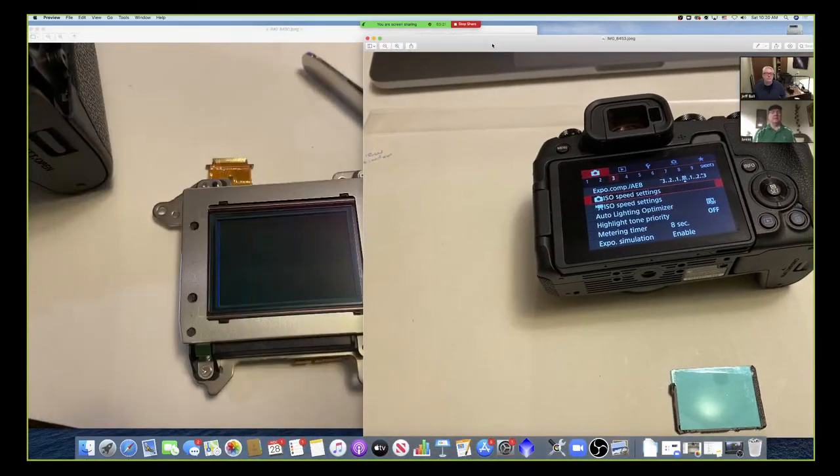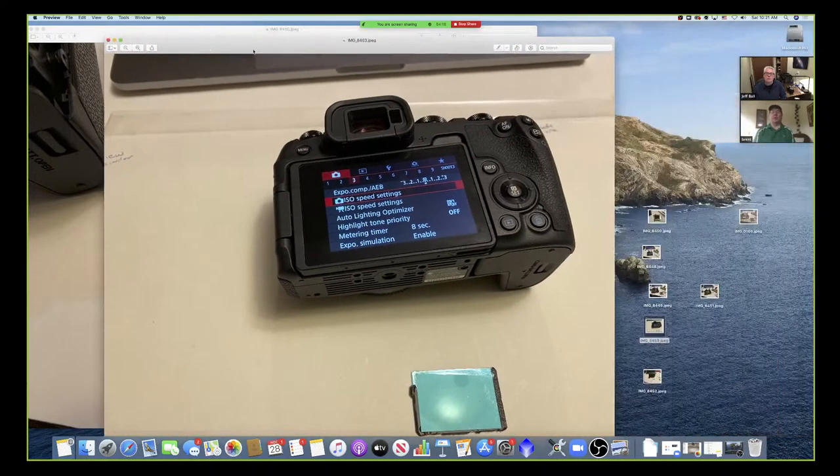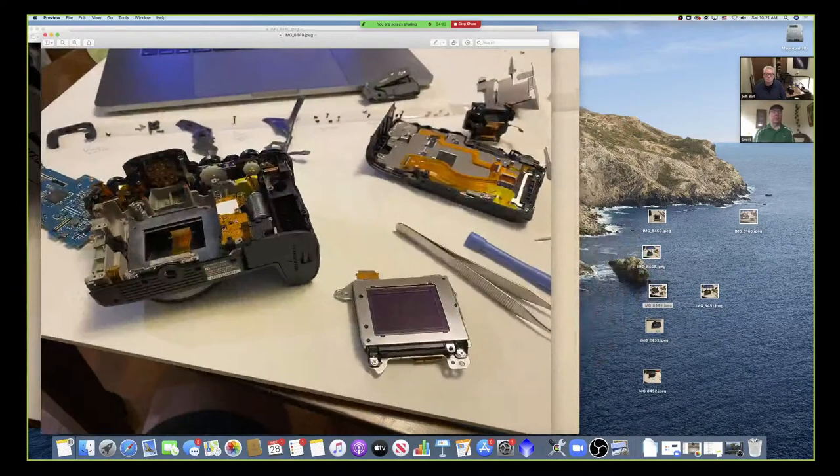This is a Canon RP, and this is the actual sensor array after we dismantle the camera. On most cameras — DSLRs or mirrorless cameras like the RP — there are two filters installed during manufacturing. One is a UV-IR cut filter, with strong cutoff lines around 400 nanometers in the UV and about 720 nanometers in the IR. The second filter, the one that we want to remove — you can see it there on your screen, which has a greenish cast — is an absorption filter that absorbs most of the hydrogen alpha line.